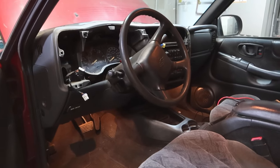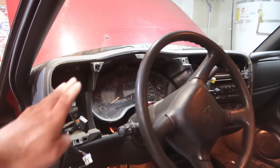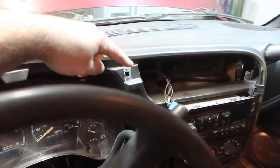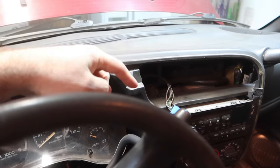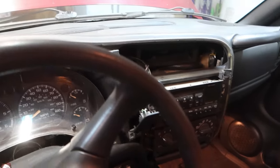The first thing we're going to do is install the switch panel, and you can see the dash. I already have this dash out because the 4x4 switch up here — the solders I think are broken in it — so I'm going to try and re-solder it or I'm going to have to replace it. I already tried two different switches and they're very intermittent, so I've taken the circuit board apart and I'm just going to re-solder it. Hopefully that will fix it.